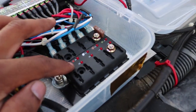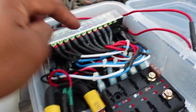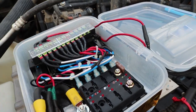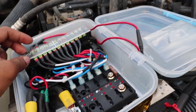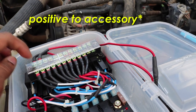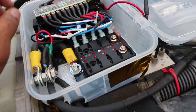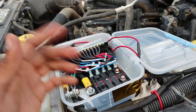I have blade fuses — it's called bladed fuses. That's where the primary power goes, right here to the primary power, to the fuse, to the relay. So then I have five relays under, and I have space to add five more. But for now I don't have that many accessories or lights, so I'm just going to keep it at five. This is the distribution block — this originally was up here, I just moved it to here for now, double-stick taped it to the relays. So you pretty much have four posts per accessory: your main power from the battery and your switch power. Your switch power just comes from your switch, which triggers the relay. I didn't make a video on this because I pretty much just watched a video making it — I'll leave a link up top on what exactly I watched.